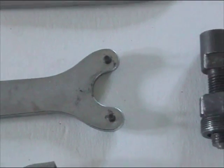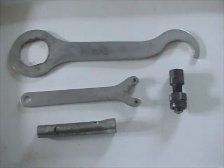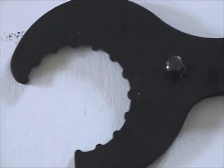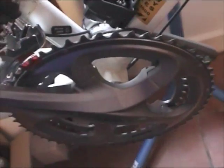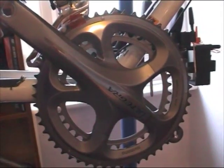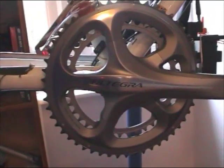The old Shimano 105 crankset and bottom bracket were removed, using an old toolkit, and the new Ultegra bottom bracket with external bearings was fitted. Here are the fitted external bearings together with the new external crankset. External bearings apparently allow a bigger diameter axle, which is therefore stiffer for the same weight, but I found there was more friction when you spin the new chainset than with my old internal bearings, which used to spin forever. You can see the friction here, though I guess you don't notice it when you're actually cycling.